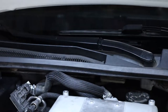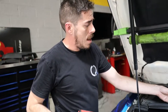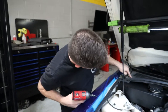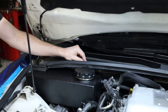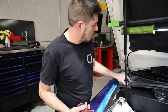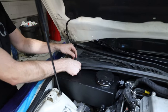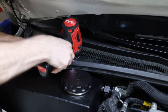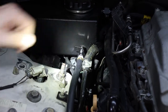Go ahead and throw these 7mm fasteners back in. Note that if you just run them straight in they'll go right into the tank — there's minimal space. This one has a little more space; this other one has practically none, so I'll shave it a little shorter. On the tighter one you almost can't put it back unless you shave it really short. This one is enough to hold it where it needs to be. The drain valve is open right now — flick it that way and it's closed.